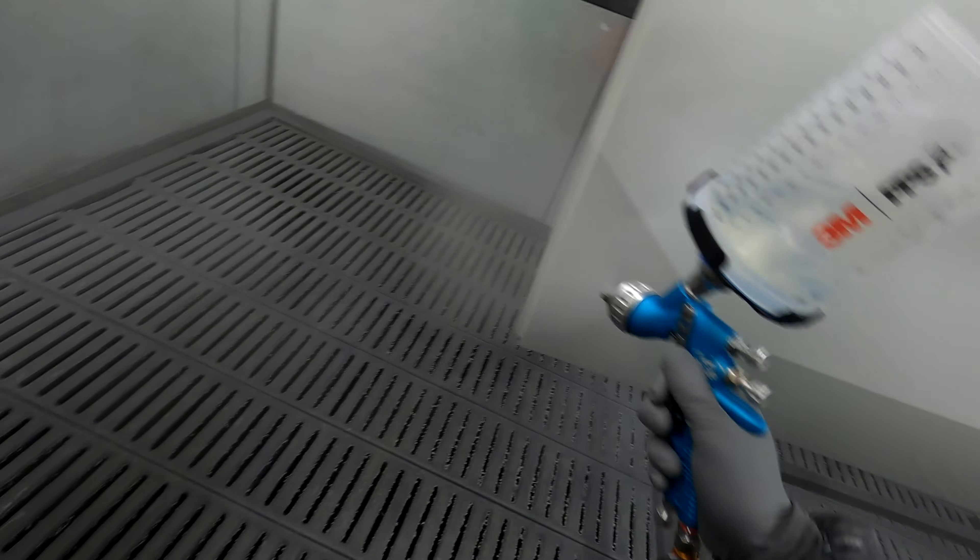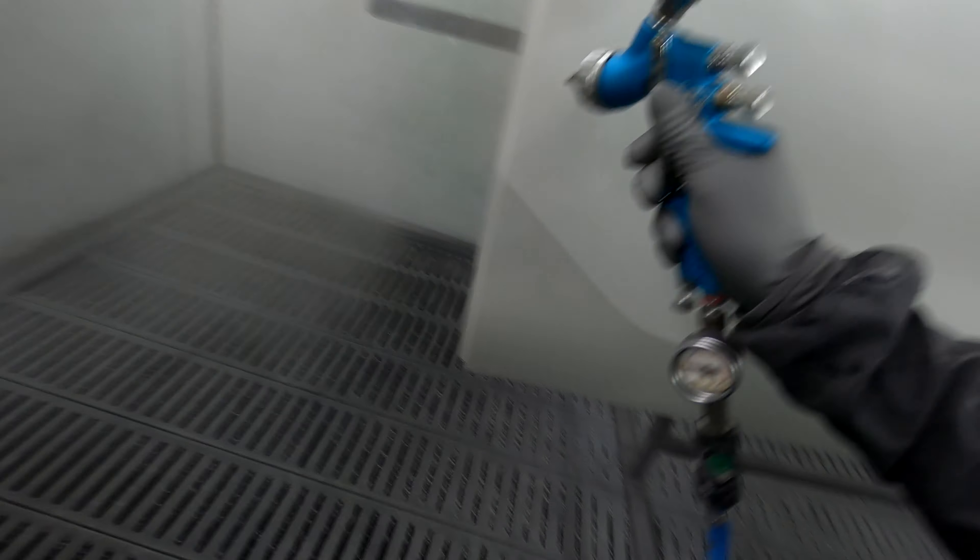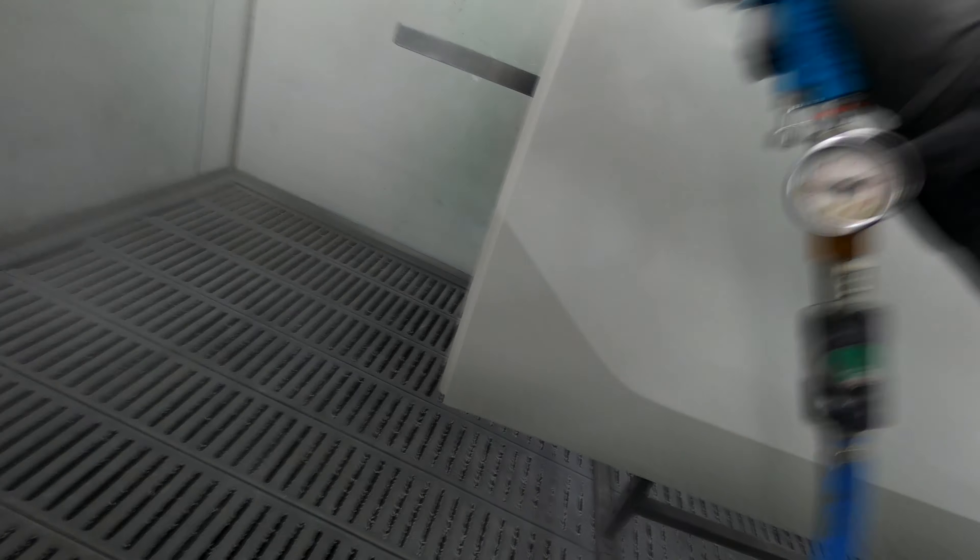TE20 as I said — I've actually lowered the pressure down a little bit, because these are European cars. Especially the Mercedes and the BMWs, they've got a little bit of a thicker orange peel. I've found if you go too far on European vehicles with this clear coat, you'll get too fine of a finish. That's why I dropped the pressure down a little bit — going nice and slow, going for that thicker peel.